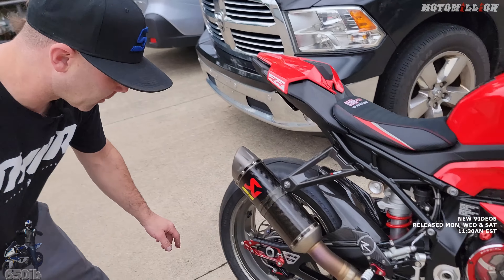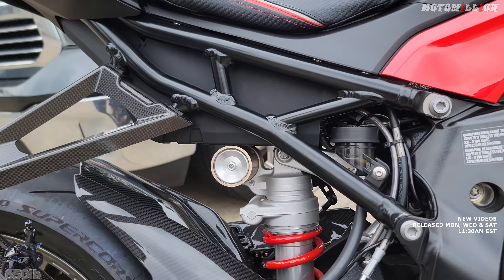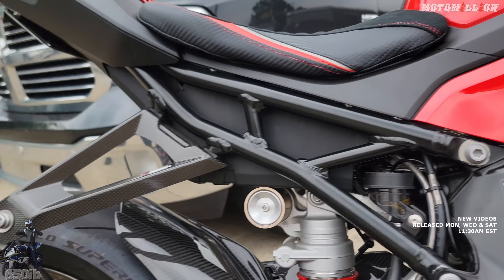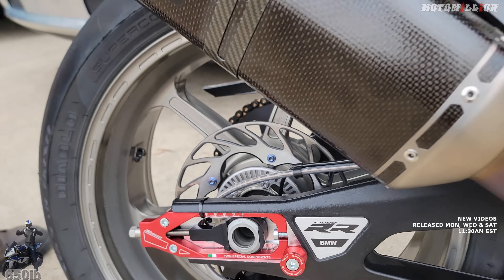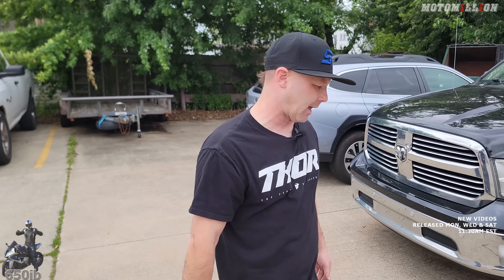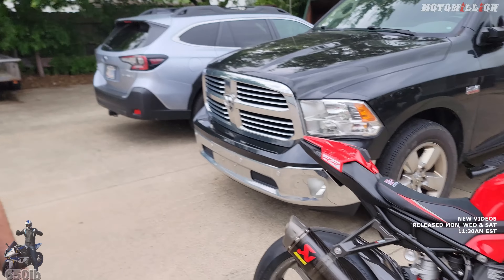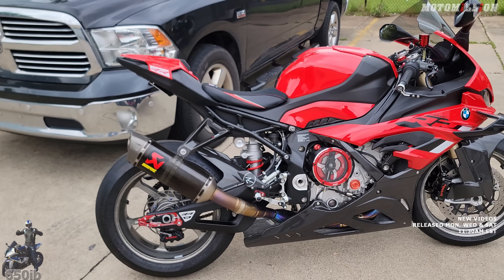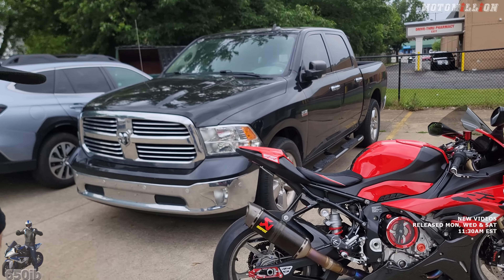Successful test ride. I just wanted to check real quick—make sure we don't see any drips. We don't. Nothing dripping from under the seat. Our brake fluid level stayed right where I set it, and none of our hoses or cables are rubbing on anything that spins or too close to the exhaust. That's the biggest thing to watch out for if you're doing an install like this—make sure that line stays put. We double-checked our wheel speed sensor function, cruise control worked, hill assist still works. It didn't seem to squeak and had some decent rear brake pressure. Successful, and it matches the front.